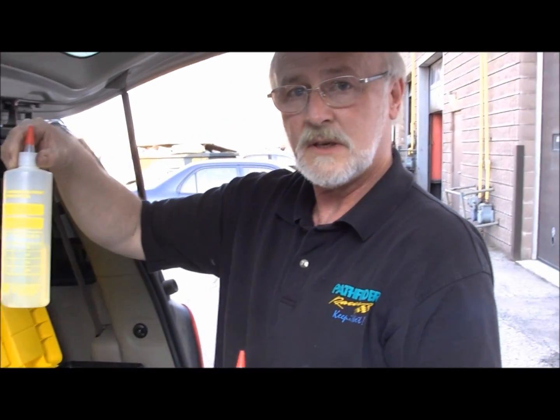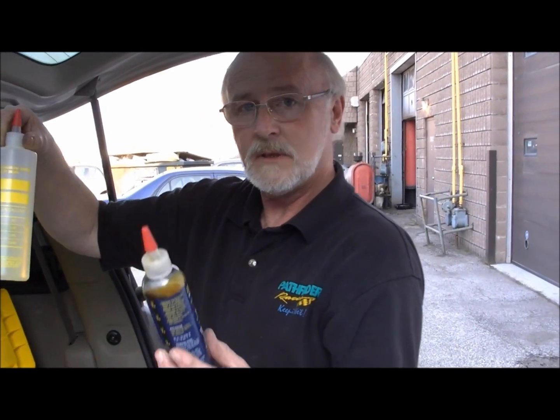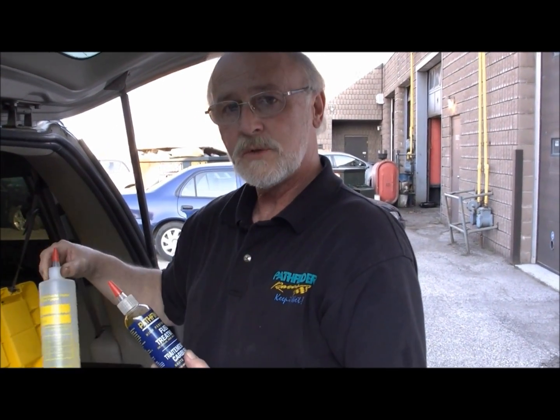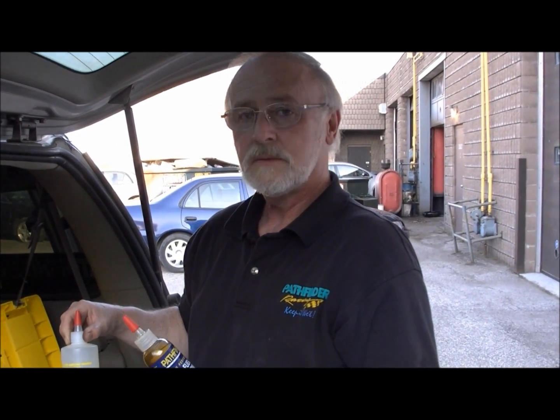With the gasoline that you picked up — the 94 — you're gonna put in the tri-jet, mix it up, put it in the car and give it a little spin for about 10 minutes to slosh through and mix up. Go back to the dyno and away you go. You'll see your air and fuel mixtures change, probably within two to three pulls. You're done.